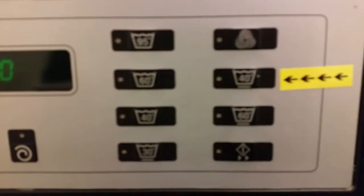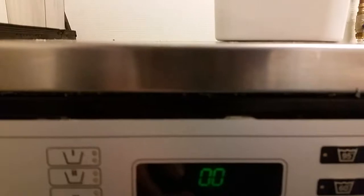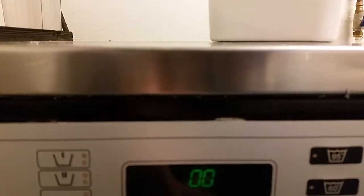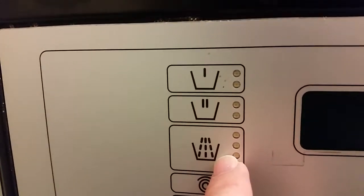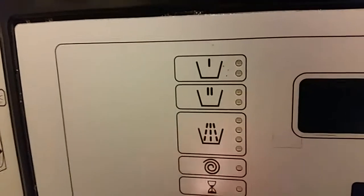95, we haven't even checked that out. There's something with the program module. If you use the synthetic 60, it washes to the second point there, and after that it just stops and does nothing. And on 30, it doesn't rinse at all — it just skips directly to spin.